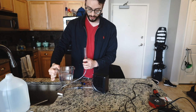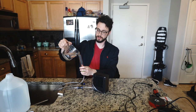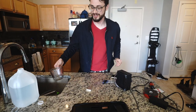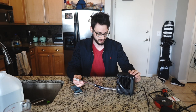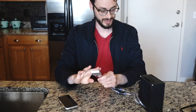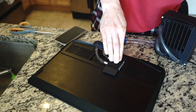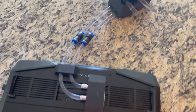I do have the pump mounted below the radiator but I do not have a reservoir. Without a reservoir it's going to be hard to get rid of all the bubbles, but this does seem to be working to flush them out. I think the loop is full now. The pump is not quiet — don't buy this pump, it's very loud. I was concerned about the fan speed but now I can't even hear the fan because of this pump. I 3D printed some parts to hold the water block on as well as little legs to lift the laptop up so there's enough clearance. The back plate is flexy and that flex actually helps compress the water block onto the thermal paste. I have no idea if this is sufficient thermal coupling but we're going to test it and see.